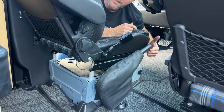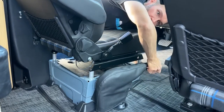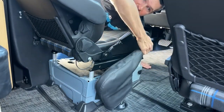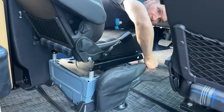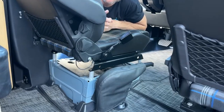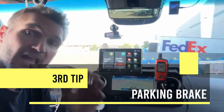You can tell the parking brake is off because when you lift up, you'll hear clicking. Press the button, lift up hard, and push it back down — that was released. If it's going up and down with no clicking, it's still on. That is how you get the parking brake off — it is not stuck, it was designed to be pressed down.